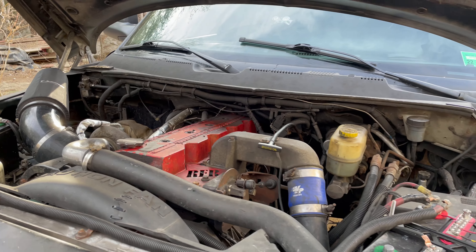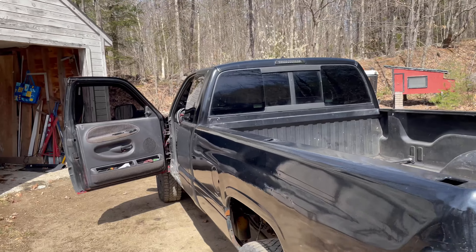The truck has entirely fixed itself. Brake lights work how they should, reverse lights are now working again how they should, fuel gauge is working how it should, speedo is working how it should — literally everything is working great. I cleaned all the grounds and even after cleaning all the grounds it did not help the brake lights, but I went under here and cleaned the absolute hell out of the trailer light switch that was corroded, and that is when I drove into town to get the brake light switch and it fixed it. I think most of my light issues were because of that corrosion in the trailer switch. I'm going to try and put a cover over that so it doesn't get corroded anymore. Truck is officially good.